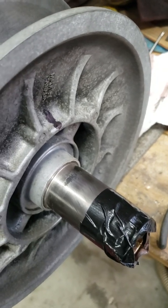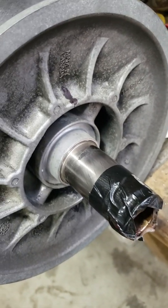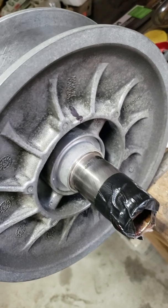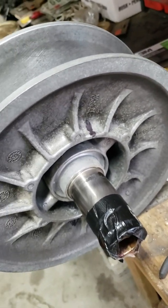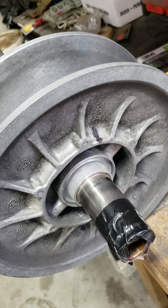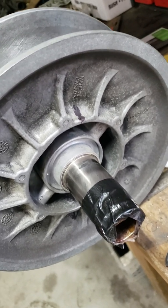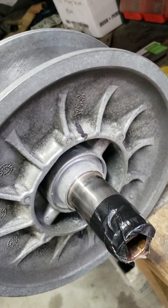What I would recommend doing instead, because this system really stinks the way they're doing it, is that the older way with the C-clip on there was good. I would go to C&T Power Sports. They're in Troy, New Hampshire, and C&T will still sell you, I believe, the dry bolt, the bushings, washer, and the C-clip. Put that in. I never had any problem with the old style. That worked out fine, rather than trying to go with this, because if you ever bust that pin, oh man, it's going to be a hard time trying to take it out.